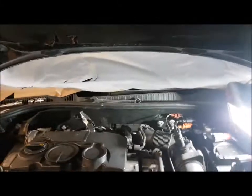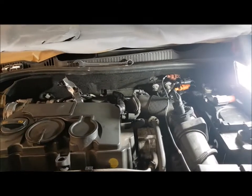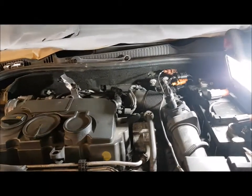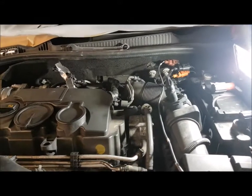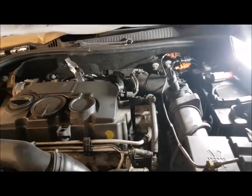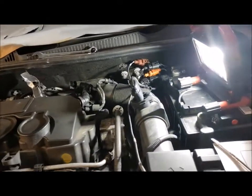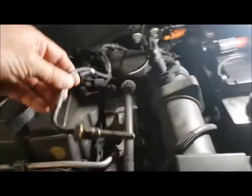There's very little information as to which one is which and to which one to try. Until somebody said, well why don't you unplug each sensor, run the diagnostic, and when you've pulled the sensor off and the fault is still there, that's the faulty sensor. It sounds so simple that I'm really embarrassed I didn't think of it. So what it turned out was this is the sensor which I've managed to get off.